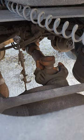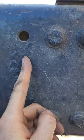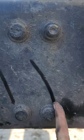Minimize the angle on your rear drive shaft by raising your airbags, making sure your driveline angles match up. If the rear drive axle pinion is pointing up, the front drive axle pinion going to it must match the same angle.